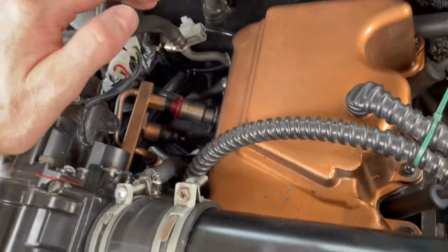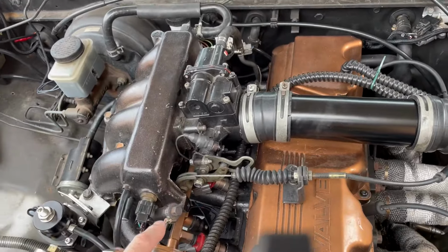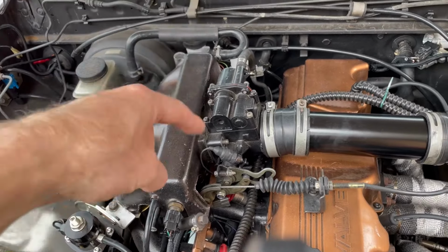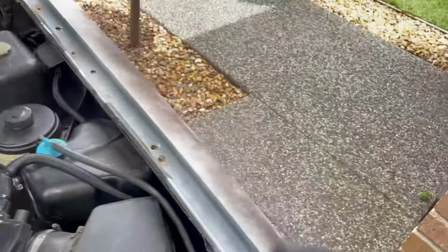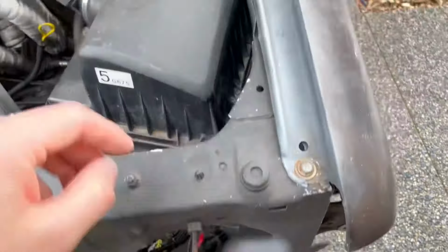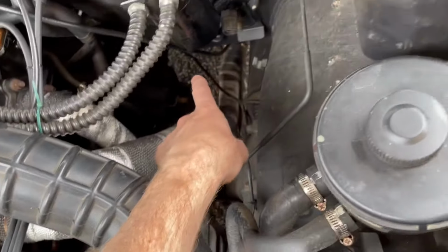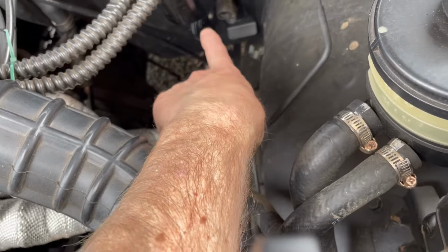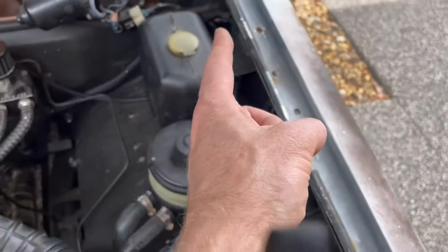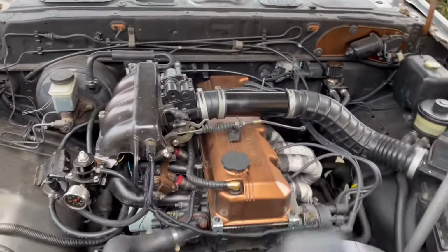Got the O2 sensor. What I did was I took the intake off, took out the injector loom, pulled it all apart, and then rewired it to go backwards rather than forwards. Then I've got another part that runs down the passenger's guard, which is passenger's headlights, horn, map sensor, window wiper, and window washer. It comes down there and up the back here and then tucks in under, into the guard, through there. So it's looking a bit neater.